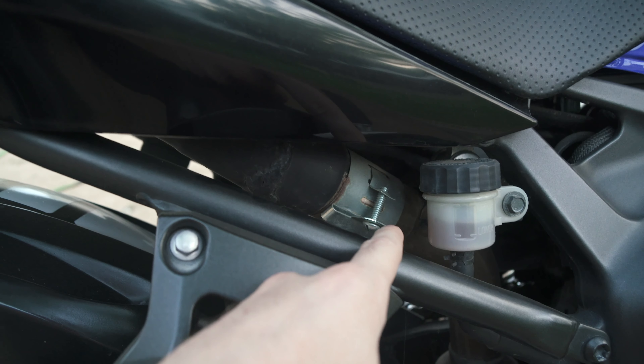And then I also cut a hole — you can see there — and I actually welded the other pipe to connect the second muffler. It's actually quieter if you only connect this one exhaust pipe — I have no clue how that works — but with both mufflers connected up, it's actually louder than with just this one muffler. So that's something to keep in mind. I did want to connect it just because in the cold when you cold start it, smoke would only be coming out this side and it would look weird. So I just wanted to avoid that. It just routes the exhaust out both sides, just like the stock one does.